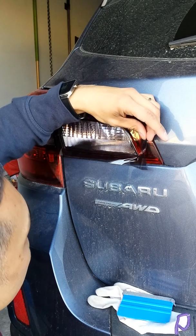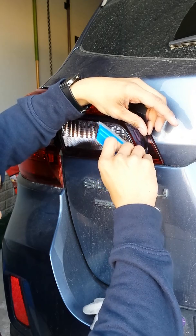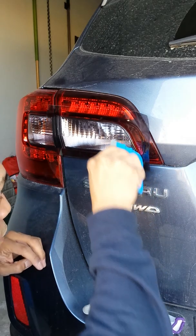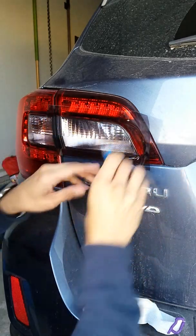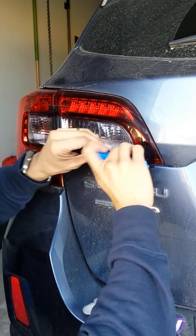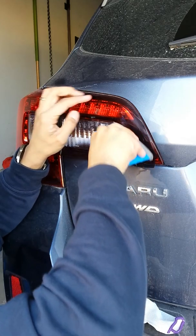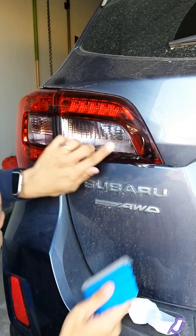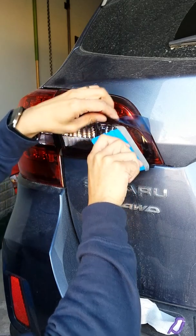You can see the film's gotten a little bit gummy - carefully put that in there just like that. Use the hard edge side of my squeegee to help out, making sure that's all the way in there. Giving a good amount of pressure, twisting and turning. Basically I'm almost done - there was an air bubble there and I just squeezed it out. This does have air egress technology like regular vinyl, which is really helpful in applying this.